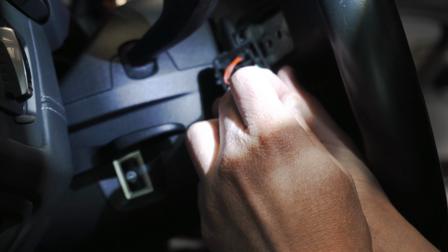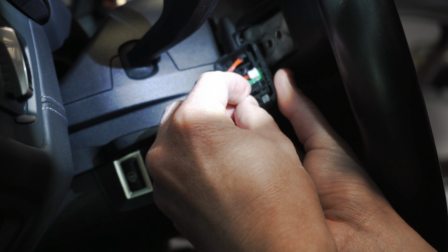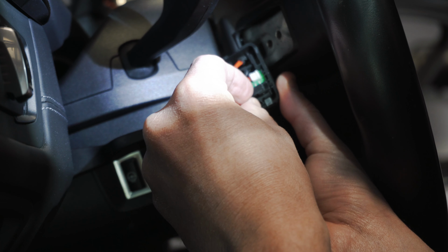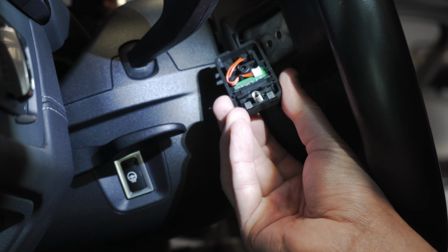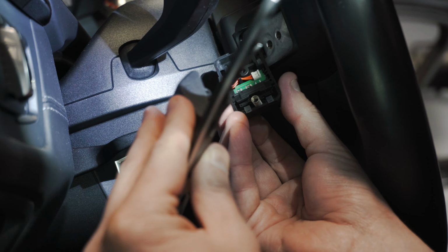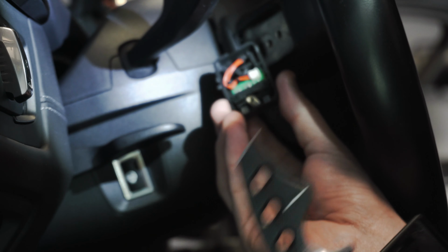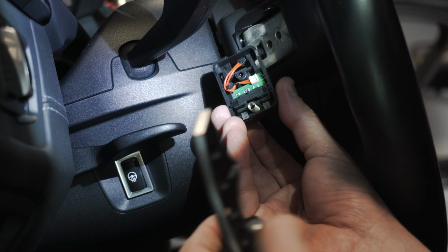We're just double checking to make sure that this still stayed attached, in case that popped off, that just goes over that. It's actually what pushes down on the paddle. Take that spring that came loose, we're going to put it back over that little peg there. Grab our newly assembled paddle shifter, and we are going to take the thing with the plastic bar. Obviously, it's going to go in the back where those two holes are.